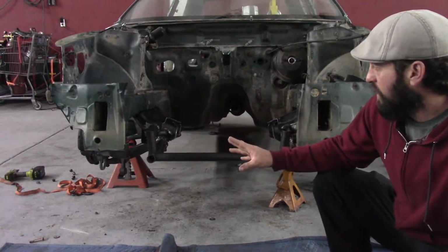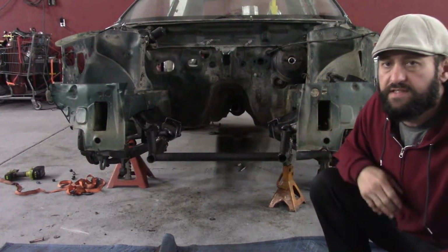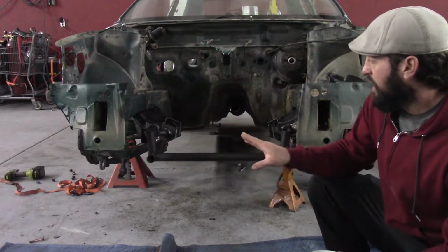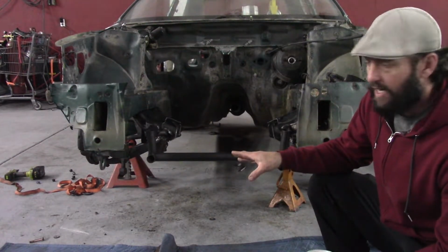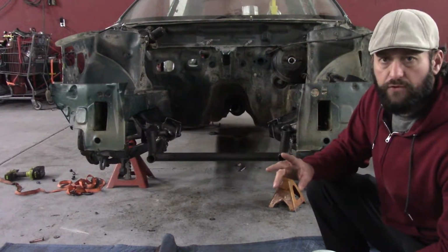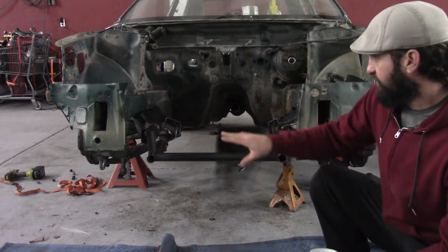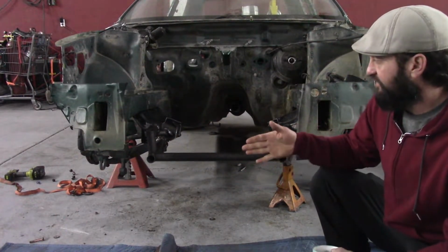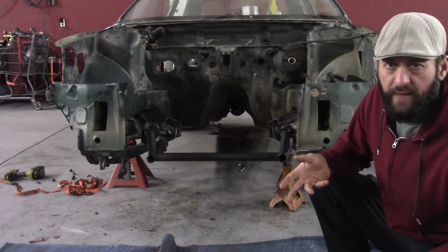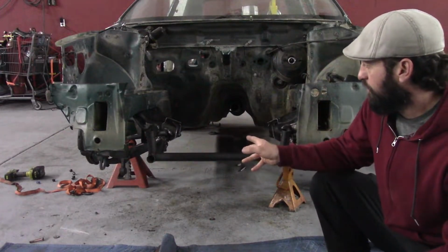If I keep it that wide and underneath the control arm, then anyone that wants to do the front CV axles with an LS-style V8 will be able to do exactly like I'm doing. But it also means that I will be able to use a stock steering rack, because everything will be out of the way of that. If people want to do a rear steer convert with an LS and use a truck pan, but only have two-wheel drive, they'll be able to do that.